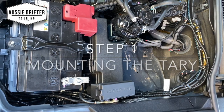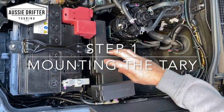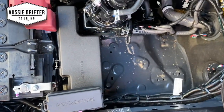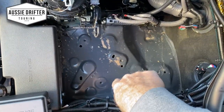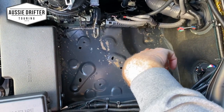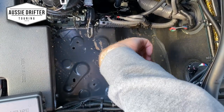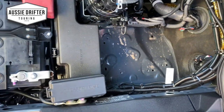The first step is to place the battery tray into position. You can see we're right behind the start battery and the fuse box — that's where our battery tray is going. We're going to utilise a lot of the existing holes. We have to drill one or two holes in here, but we'll utilise some of the existing countersunk holes. Our back foot is going to go down in the back corner. So we'll place the tray into position now.